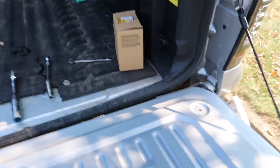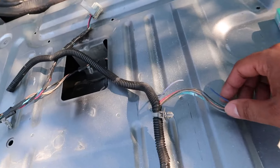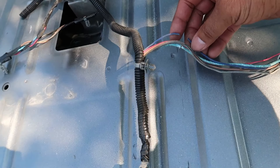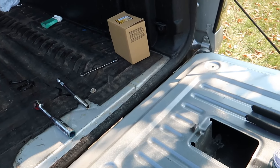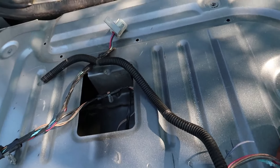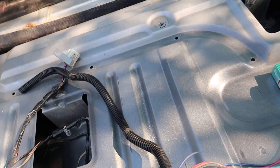Quick little tip: if you've got a 2007 to 2013 Chevy truck — pickups, Avalanche, Silverado, whatever — and your backup camera goes out, don't be like me and buy a new camera only to find out that's not the problem. There's my new camera that I plugged in and nothing worked. I ended up pulling the tailgate harness off and found it was broken. Before you spend 80 or 90 bucks on a new camera, pull the harness and check for broken cables. From what I read on the forums, opening and closing the tailgate all the time makes the wire get brittle and snap.